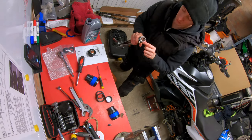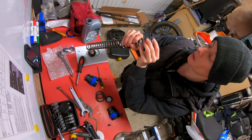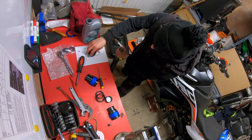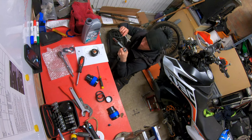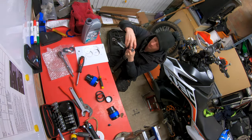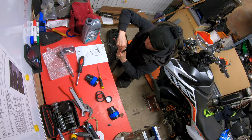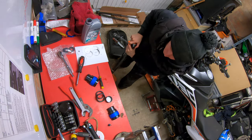I've put the spring in — it's got numbers on the top: this is 6.0520 — no idea what that means, probably to do with spring weight. So that goes in like that. Then you can get a 15mm spanner, pop it on there — that'll hold your spring and you can screw your top on, making sure you get the right top for the right fork. This is the right-hand fork, so it's the rebound one. It's easier for me because I've only got one left.